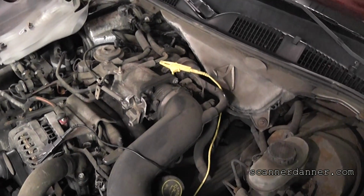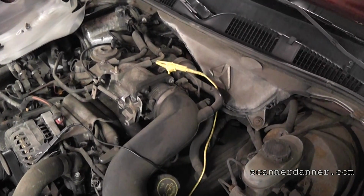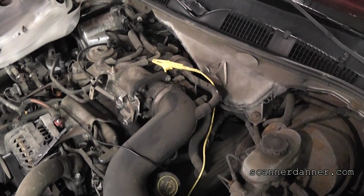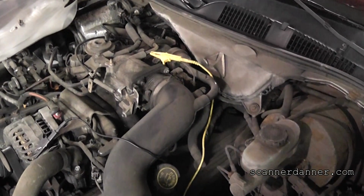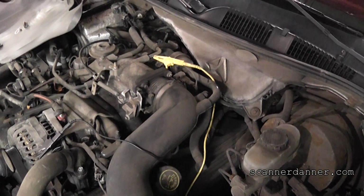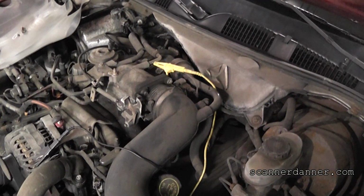Lastly, the symptoms, again, I want to stress this, would be the car runs fine with your foot on the gas pedal, and that's key. If the customer's complaining of a stalling problem and they say that it doesn't run well with your foot on the gas pedal, you have more than an idle air control valve problem. In our case here, this vehicle runs fine, but would not idle on its own. Your first place you're gonna go is toward the idle control device on the car.